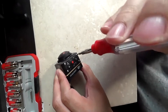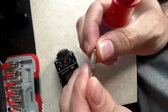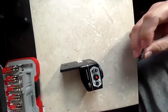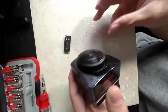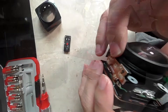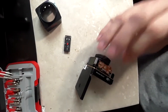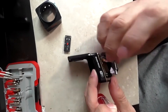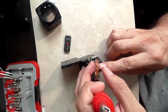The four front screws are optional and you will need a Torx 5 screwdriver tip. Once you take the front button cover out you can use this time to clean it. Then just lift out the cover and you have full access to the camera lens. This part is optional, but you can also remove the controller board for better access to the actual lens — just be careful not to damage the ribbon cable, as doing so could kill your camera.